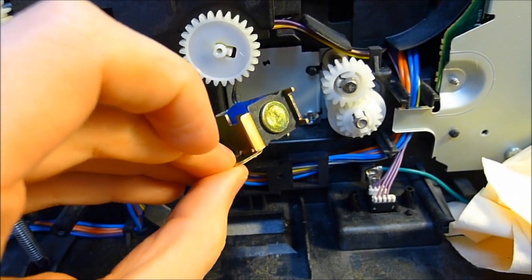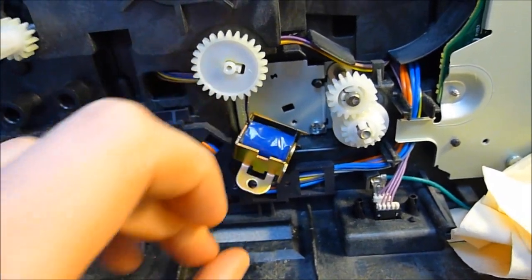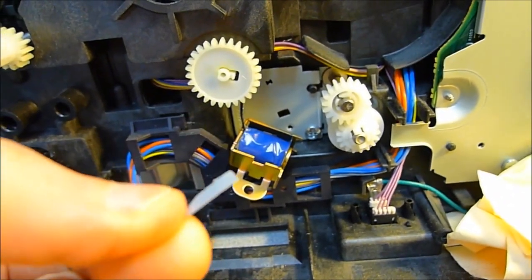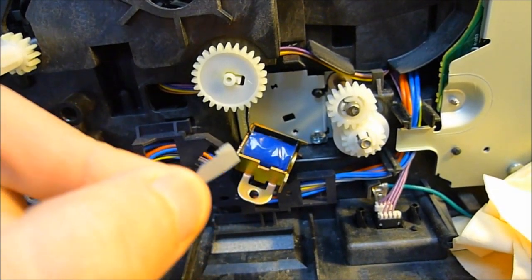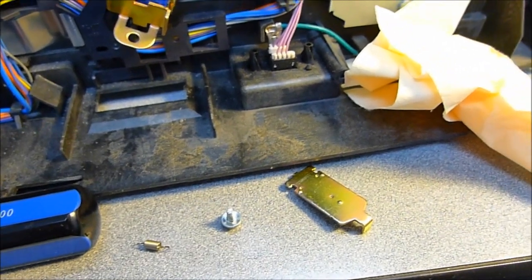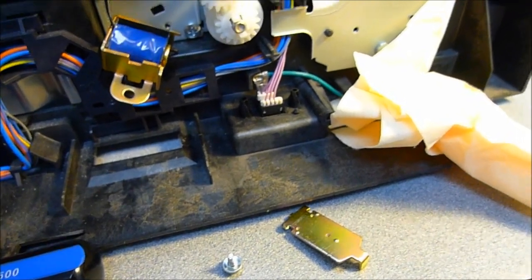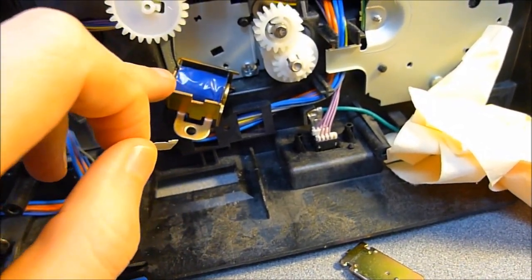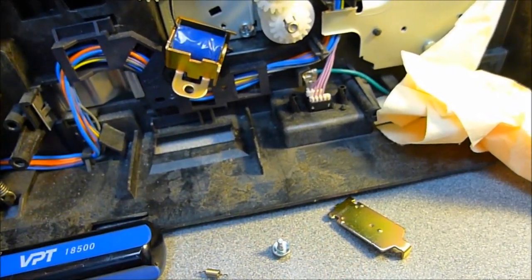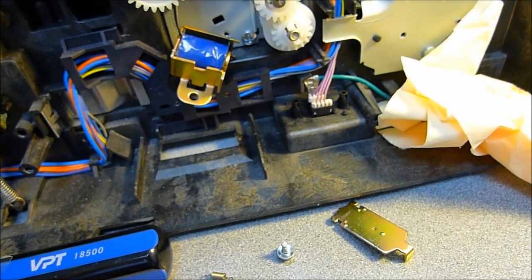While I was doing this, I looked online and it seems that contrary to what I said previously, what we actually want to do is take some kind of piece of plastic or some sort of non-magnetic material and stick it back in place where the adhesive used to be. The reason is that a lot of times people just clean that off and don't replace it, and then there's a problem with residual magnetism from the solenoid — it fires, causes the metal to still be slightly magnetic, and then you have the same jamming and timing issues, because all it takes is a microsecond of delay and the printer will jam.